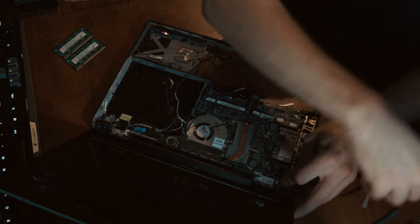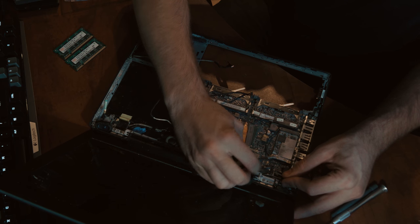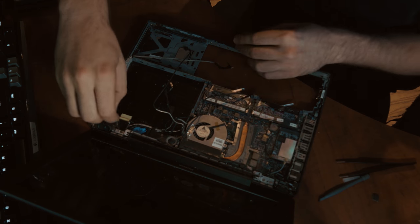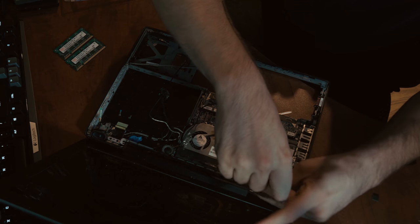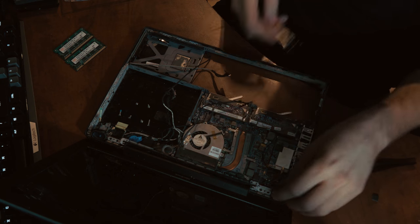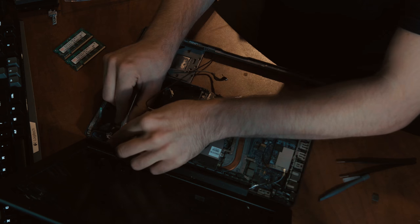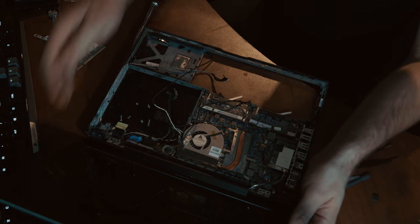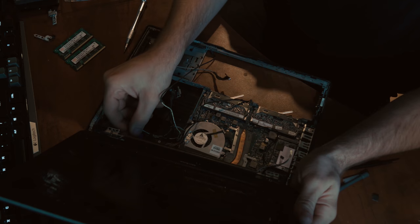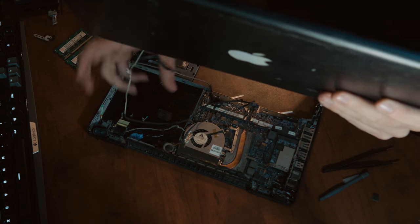Under that foam is another connector — just like the speakers where you get under the plastic and pry it up ever so slightly. There are two screws here: one long, one short. And again with this side, these two screws. Now we should just be able to pry this up a little bit there, get that over the plastic. We should just be able to lift the display straight up. There are still wires under the subwoofer cable — and there we are. Now we have the display.